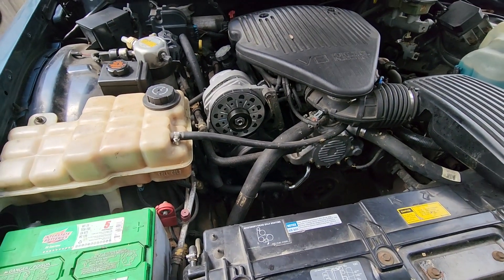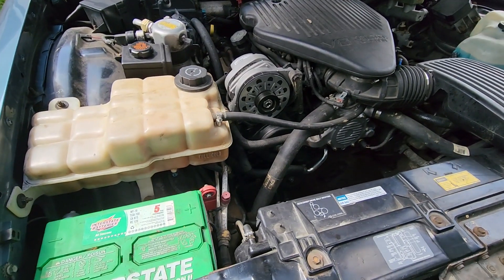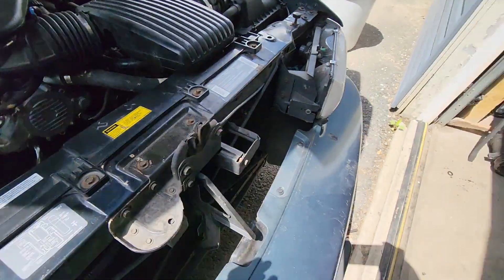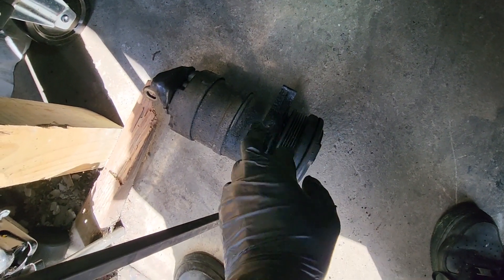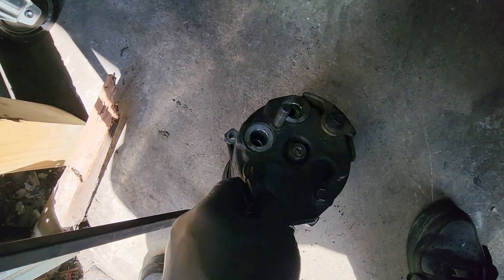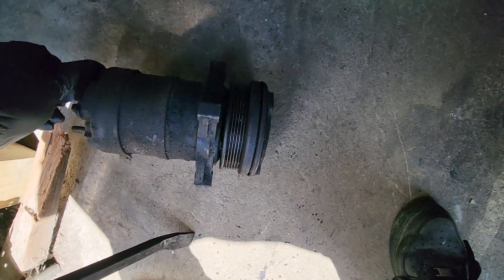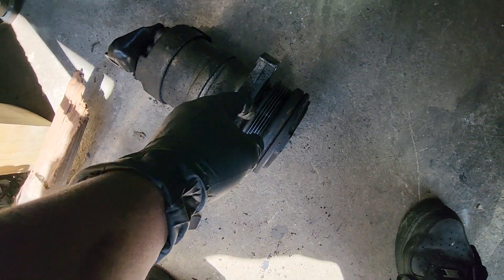I did the dye situation - as you can see it was green - and I saw a little sparkle here and there. I figured I'll just replace it. The guy said he couldn't really figure out exactly where it was coming from without taking it apart, because it was sprinkles of dye all around. But would that be enough to evacuate the whole system in a day? He was saying maybe not, but either way he recommended going ahead and replacing it because it was definitely seeping out.